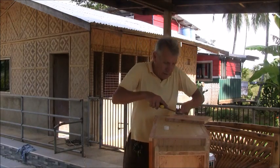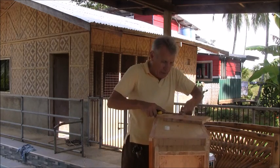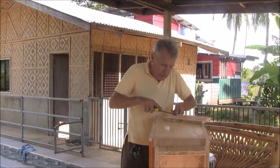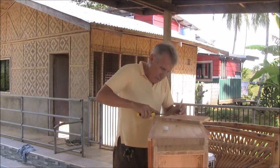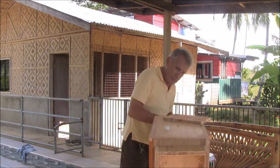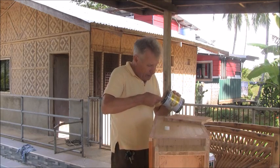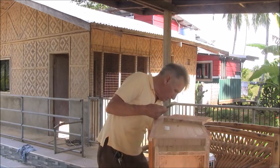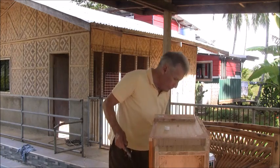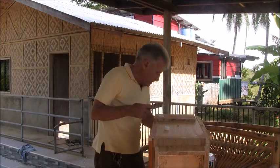And this as well. It's a good idea not to put this spatula with the not quite yet cured Bondo back into the pot, because it will affect the workability. So about the same again. Seems like this is a pretty good amount for this temperature, for this situation. Once again, a tiny bit.